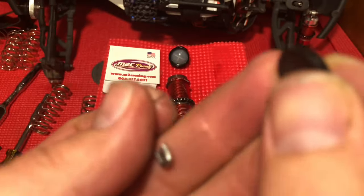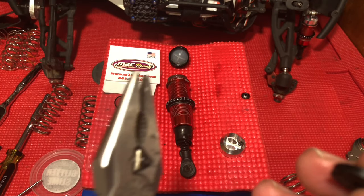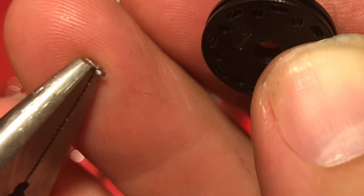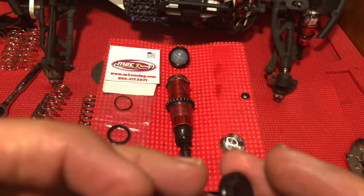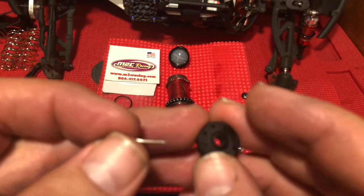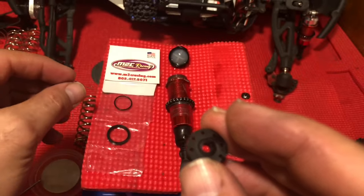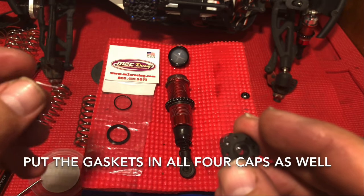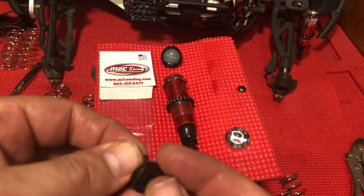In a lot of these holes you'll find a defect — a little flap stuck in there. You want to get all of these out. It's tedious but those flaps will get in the way of the special functionality of these shocks. Do a close inspection on each piston. I recommend that as soon as you open the package, inspect all four pistons getting rid of defects, then immediately put the o-ring on all four pistons to get it out of the way. You'll save yourself a headache if you forget to put one on — just grab your o-ring and stick it around.